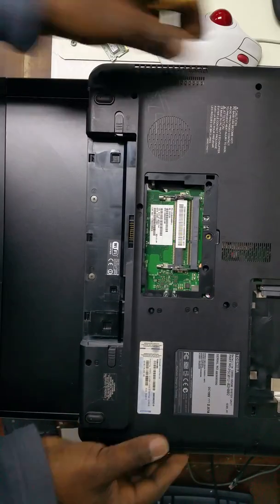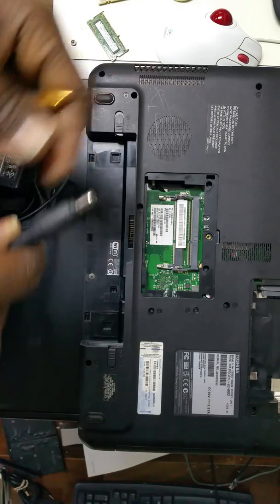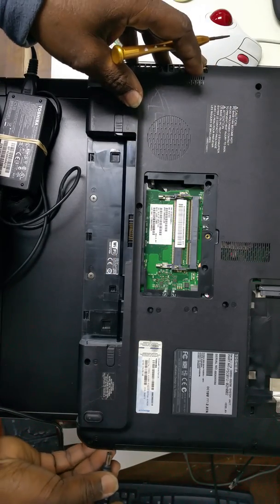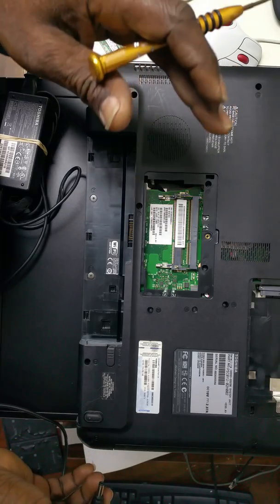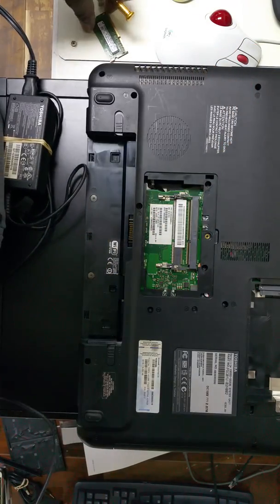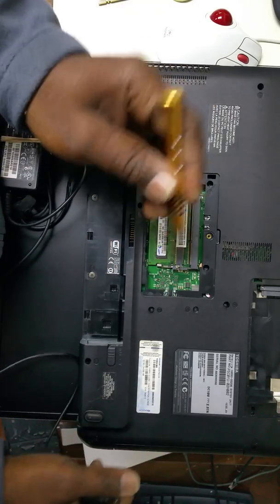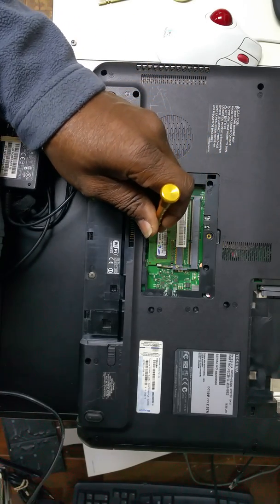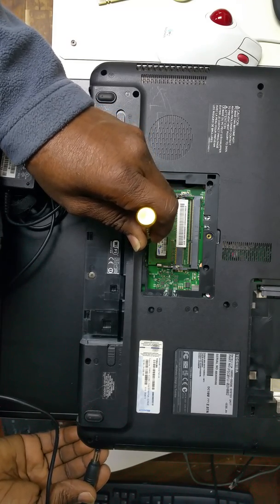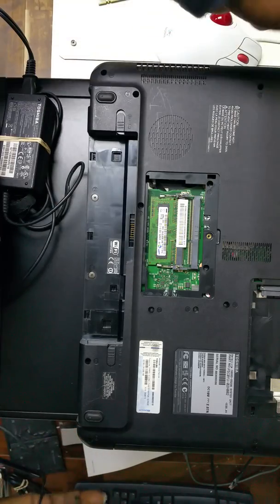There are steps that have to be taken in order for this to work. You'll need your power adapter handy. Lay the unit on its side — you may want someone to help unless you can manage all the steps with two hands. Place one memory stick in the lower slot, use your flat screwdriver to hold the two solder points together, then plug your power cord in while holding those points shorted.